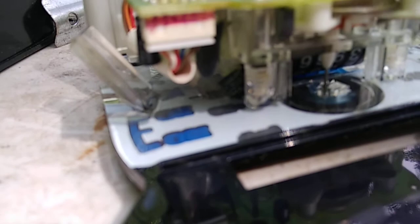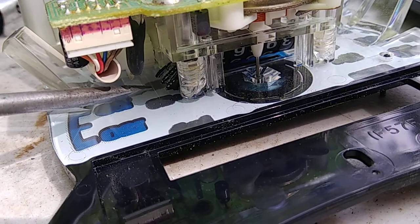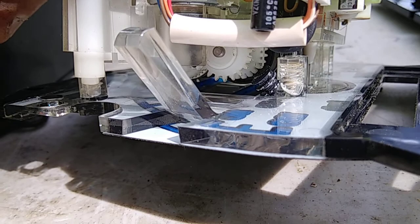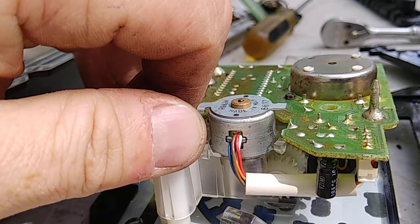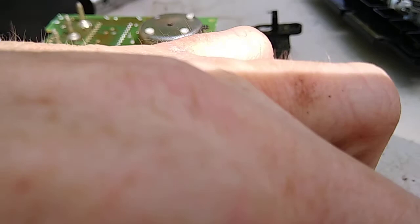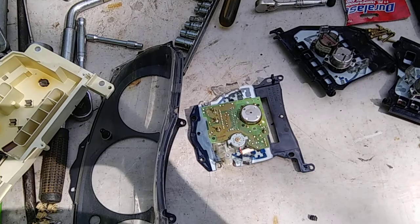You can see that little black piece in there — my screwdriver is touching it right there. That's the little worm gear, and you can see it laying down there. It attaches up here to this motor, and when the motor turns, the worm gear meshes with that gear tooth right there and turns your odometer. There it went — fell out. These things dry rot, get old and brittle, and have to be replaced. And it's crazy that something so small costs 50 bucks.